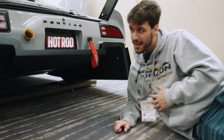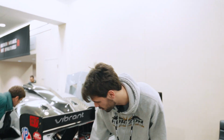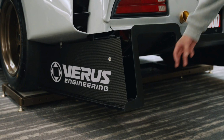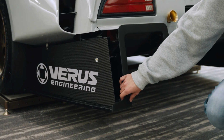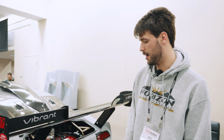So yeah, then you guys are going to test these pieces here in a little bit to see what's going on, because we also talked about there's a lot of heat due to the engine location, especially because the exhaust runs near the torque tube, so we want to evacuate heat from there. So we talked to you guys about running a stainless tube all the way back to here and putting a hole, so then because you have all the air rushing by, that will help evacuate the heat hopefully from that area. Because if you just left it open with a spot that didn't have any vacuum, it's just going to work backwards on you, which is not what we want.